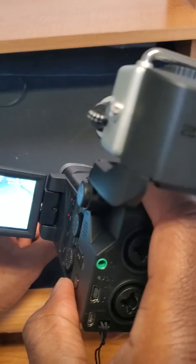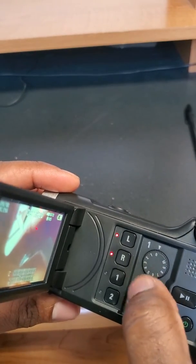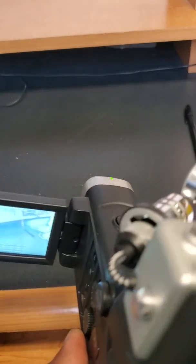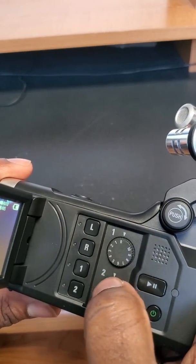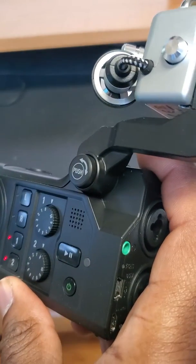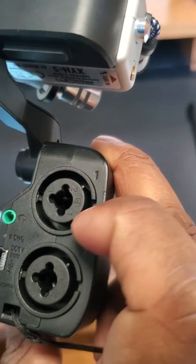When it comes time to record, first you need to select your track. In order to record, you need to select the left or right buttons — they need to be highlighted. If these buttons are off and you try to record, you'll see an error that says no channel record ready. This camera requires you to use the left and right recording tracks. If you use the one and two recording tracks, that won't work — you can turn them on, but when you record your video you won't get any sound, because tracks one and two are connected to the external microphone inputs on the back of the camera.